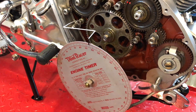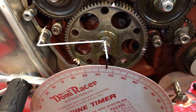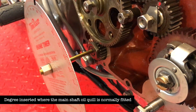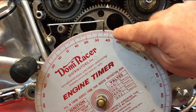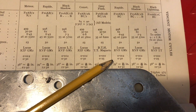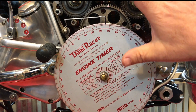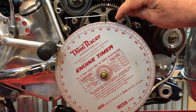Finally, I've got a degree wheel or timing disc set up — just rigged up with a plastic-coated coat hanger positioned on the degree wheel for now. I haven't set any of the timing yet. This also just fits into that quill feed on the big end, and I've marked the tip of the pointer with a black felt tip pen. Just a note about the timing: the instruction manual refers to the Rapide as 39 degrees before top dead center, but from everything I've read it should be retarded with modern fuels. So I'm going to go with 35, which is what it's set at right now as an indicator — I've read 34 as the magical number, but I'll go with 35 and take it from there.